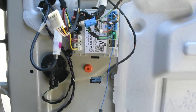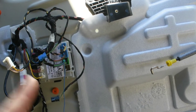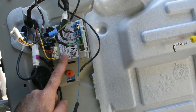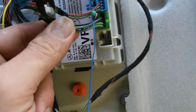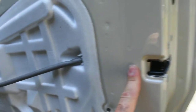Because this is not very well documented for the VS-30, I'd like to put that information out there in case anybody else is trying to do this as well. I don't know what options matter — this van has power windows, which I think they all do, and it has power adjustable seats. What we're looking for is this bundle right here. There's a brown wire, a green wire, a blue wire, and a gray wire. Those four wires go back, and if you pull out this grommet here you can see them. They go to this latch — that's the harness that you need.